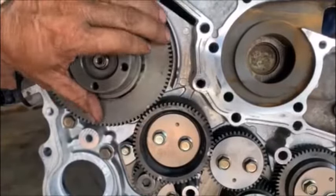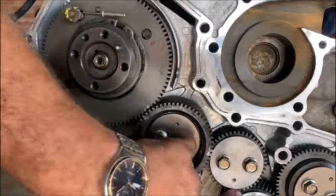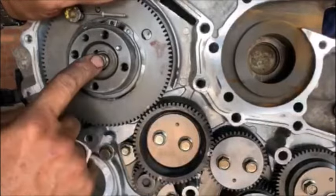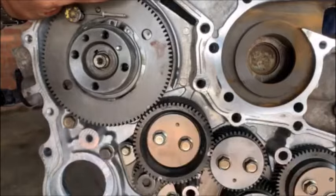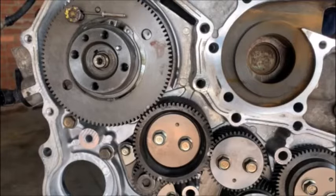And there we are. Keyway is in; those two are lined up with that one, those two are lined up with that one, those two are lined up with the one that I marked. Before we do anything, we tighten this, check everything, check all the dots that they line up, and then we put Loctite behind all these bolts, and then we can assemble the rest of the engine. So remember, with these gears the one will have two dotted teeth and the other one will have a single dotted tooth, and they just have to mesh — and that's on all of them. And if that's one tooth out, your engine is not going to start, or it might start but it's going to shake because the balance is out. So it's very important to get those lined up properly.